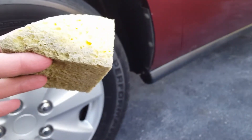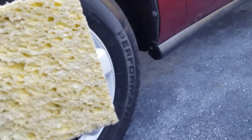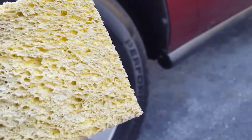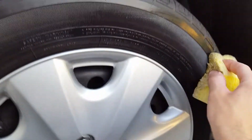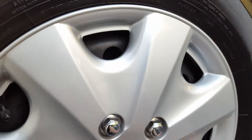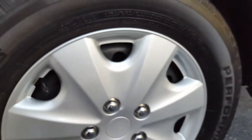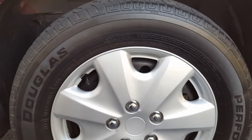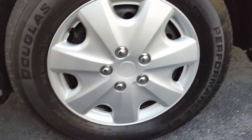Afterwards too, wring all the dressing out and then store them in a ziplock baggie. I'm going to spray some on this applicator here — as you can see I've got a little bit on here, two or three sprays. And this stuff is not greasy. It's water based. Once it dries it will get a little less shiny. Just rub it in a little bit — there you go. It's not too much, not overly shiny, but it still gives the tire a nice, deep dark look.